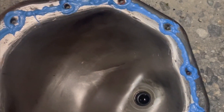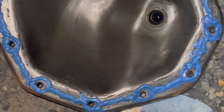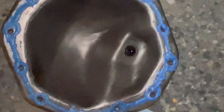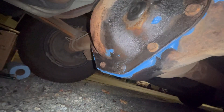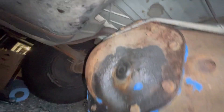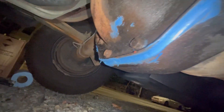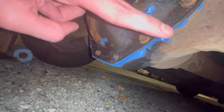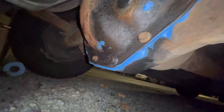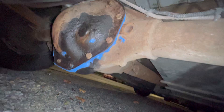I've completed putting on the RTV — I put a good bit on, circled the bolt holes, and went around everything else in a line. It's a little sloppy but it'll get the job done. With this blue Permatex RTV, go ahead and finger-tighten all the bolts. I tighten with my fingers on the socket for the best grip, then spread the RTV along there with a gloved finger. Now I'm gonna wait an hour and let that dry. In the meantime, I'm gonna replace the shocks.